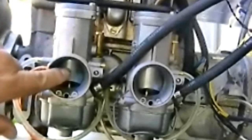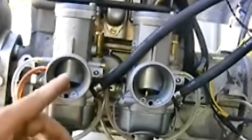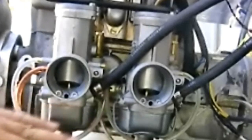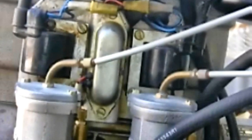What we need to do is first have a starting point for adjusting the carburetors. We have to make sure that the slide hits the bottom of the carburetor body — not just the adjustment screw. The first step in synchronizing the carburetors is ensuring the slide hits the bottom of the carburetor body.